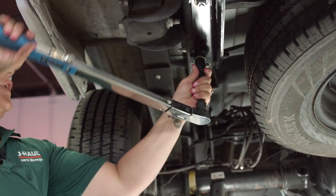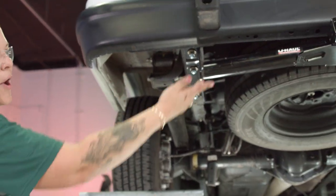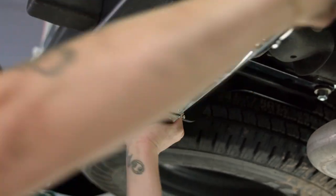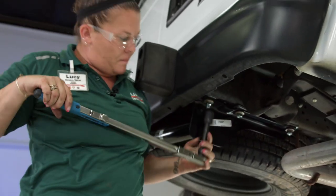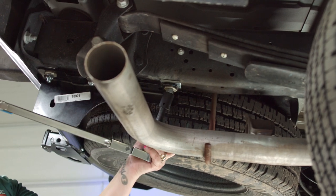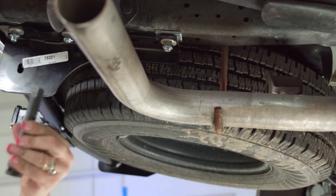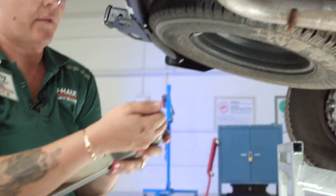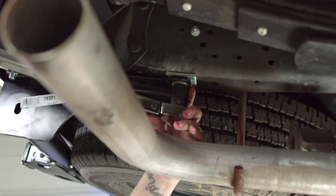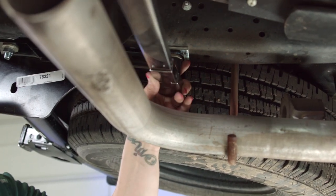Pushing is always better than pulling if possible. We'll continue the same process on the passenger side until all of them have been torqued at 75 foot-pounds. And same thing on this side — if the exhaust prevents you from using the extension, which it will, we're going to take that off and just put our socket right on the torque wrench. This is a carriage bolt again, like it was on the other side, so no need to hold it on the top to tighten it. It will not spin because of the locking spacer.